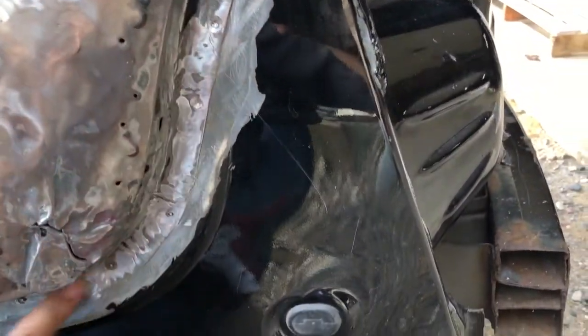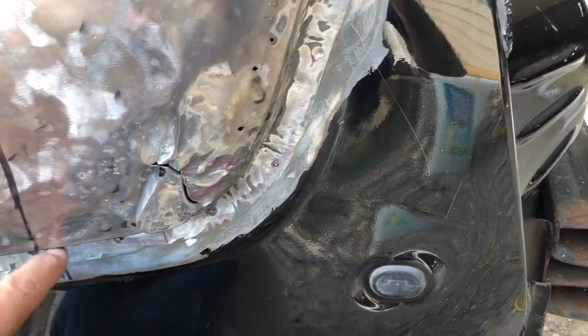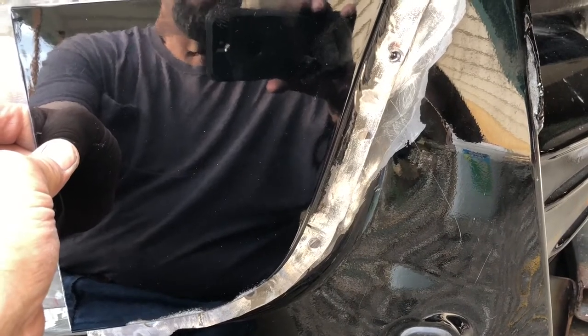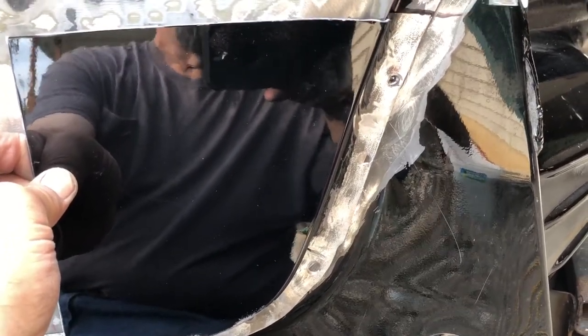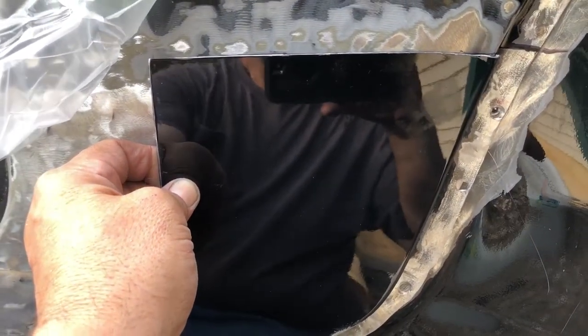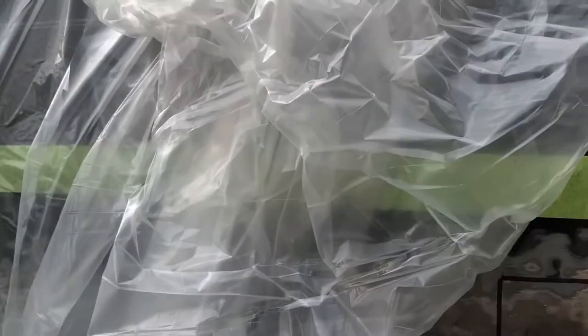It's a beautiful evening out. I've got the seam sealer stripped off with a wire wheel and now I'm going through drilling out five spot welds. Once I drill those out, I'm gonna screw the patch to the panel and cut them both at once — that way if I make any mistakes I make them in both at the same time and they'll follow along.